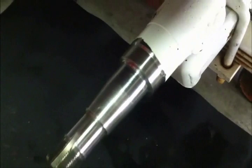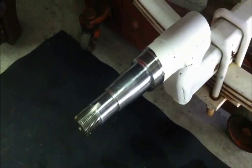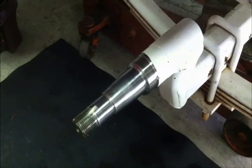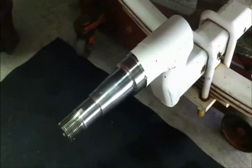I've had to do this on all four axles and it came out good - it's that simple. Now they've got a brand new surface for the seal to ride on. I wanted to show you this because I'm sure there'll be a point in time when you might have to do this. Even if you just decide to repack your bearings, it might not be a bad idea to put these on anyway. I put them on all of mine because I like the idea of a stainless steel surface for the seal - no water is going to ruin it, it's not going to pit, and the seal won't be able to leave a groove in it either.